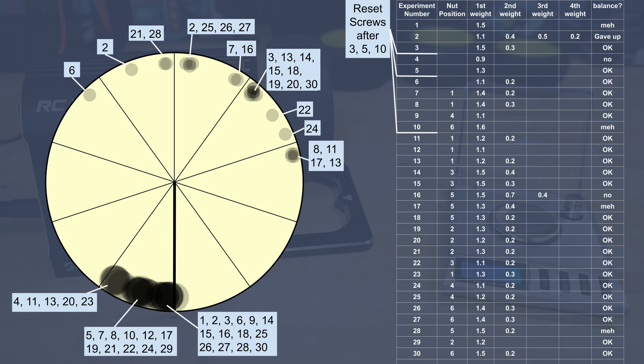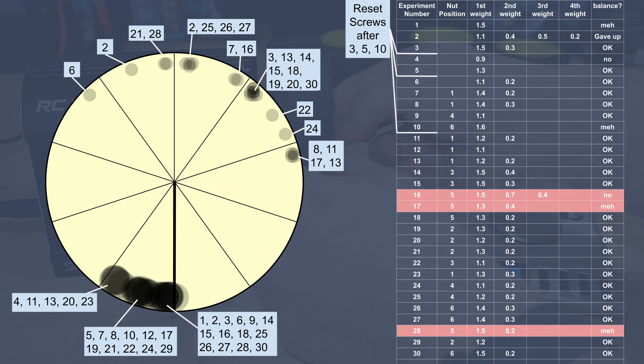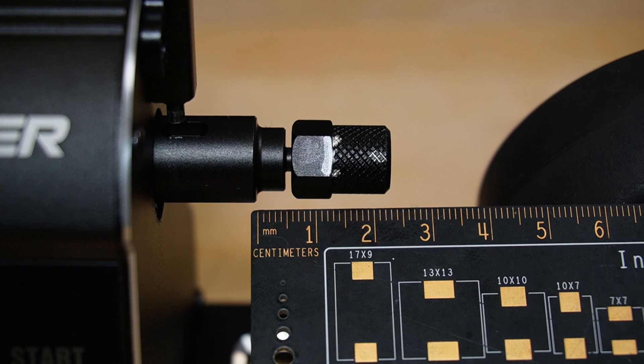For each run, I kept track of exactly where and how much mass was added. I definitely saw a difference between how the wheel was put on — there was one way that just didn't balance as well as the others. But after going over all my notes, I started feeling better. In most cases, results were quite consistent within the 0.2 gram accuracy, except for that one 'bad side' of the adapter, which was consistently giving worse results. My suspicion is that the root cause lies with the adapter itself — I noticed a slight wobble when it spun alone without a wheel, while the shaft itself did not have such wobble.